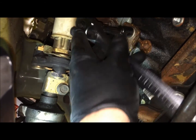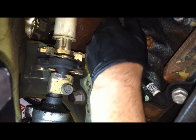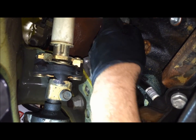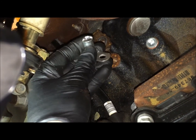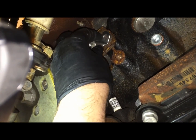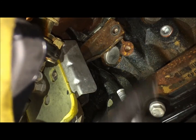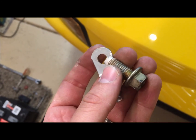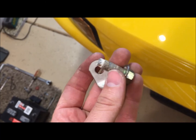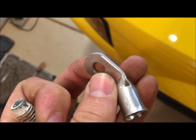I broke that loose and I'm just taking it off. It's the rear motor mount bolt — that's where we're doing our ground that goes from the battery down to the engine block. I bought some 90 degree, 45 degree, and straight attachments. This will work out perfectly to put in the bolt at the correct angle. We're going to clean up this area well with a wire brush, hit it with connector solution spray, and make sure it's a really good connection.